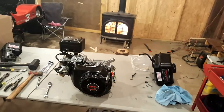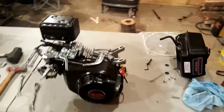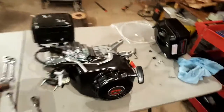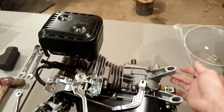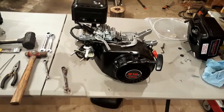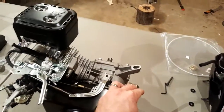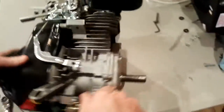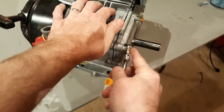Welcome back to Card Art. Today we're doing a governor removal. I've already removed the smaller stuff — the tank only requires one bolt and two nuts, one 8mm and two 10mm. I've already drained the oil. This is a lot easier if you do it right after you buy it, but I like to run them and break them in a little before I start messing with them. At this point, with the oil drained and gas tank off, we're going to focus on taking out these five 10mm bolts that hold the side cover on.